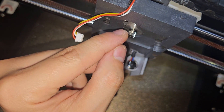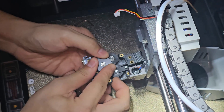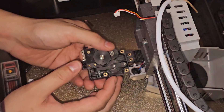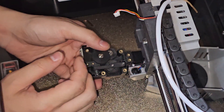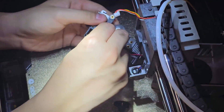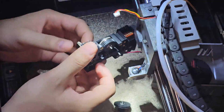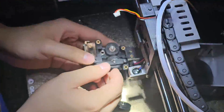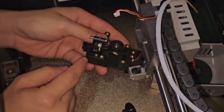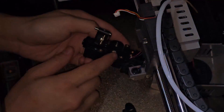I can't even turn the gear because the filament is stuck inside. There's a spring here that pushes a plastic piece to hold onto the filament so it extrudes nicely. I believe that right there is a bearing. I don't want to mess with the spring because putting it back is quite hard — I just need to figure out where the filament is stuck.